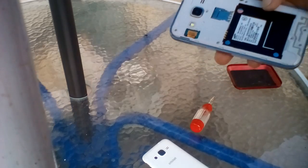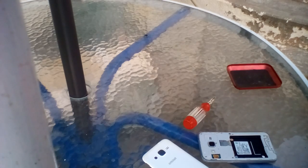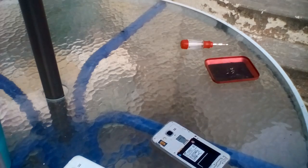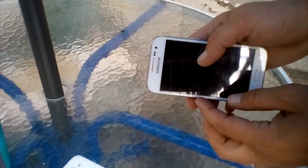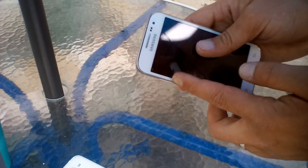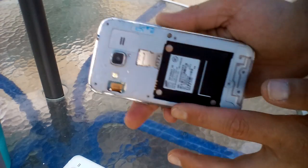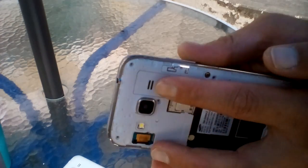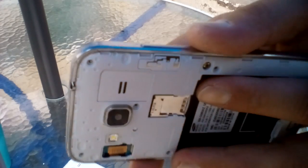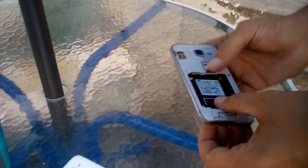Next, pull off your eight screws — I'll do that off camera and we'll be back once they're out. Once the screws are out, put your fingernails on the edge of the silver part going around your phone — all of that is the back frame. Apply tension right up here. You'll see a little groove where your speaker is, and if you're not careful it will come flying out — you don't want to damage the connector connecting it to your motherboard.